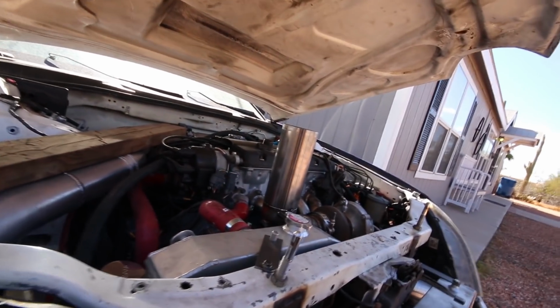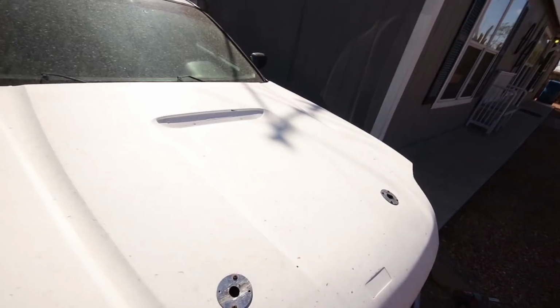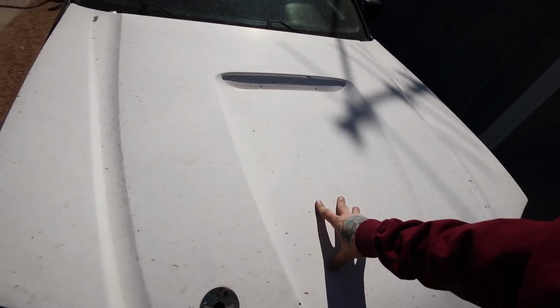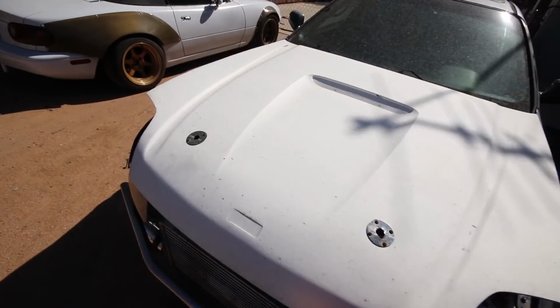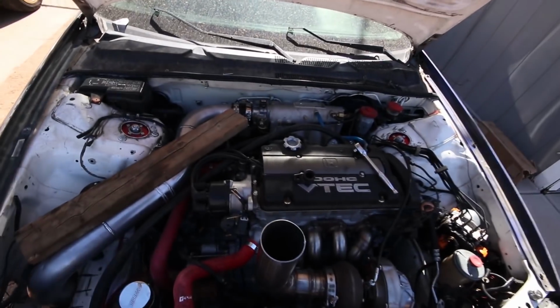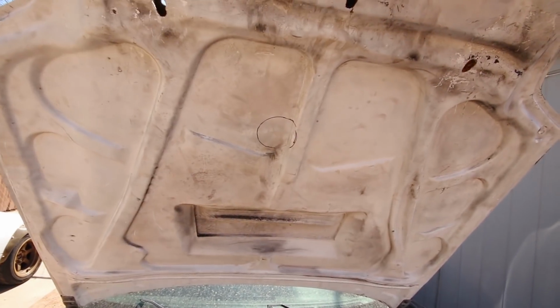Oh yeah, that'll definitely clear. I might even have to trim an inch or 2 off, but thankfully it's too long, not too short. So I'm gonna just try and push down on the hood a little bit, see if I can make a slight indentation on the fiberglass, so I know where to drill. Okay, I was able to fit my hand up there with a Sharpie. So, I have a 3-inch hole saw, but not a 3.5, so we're gonna have to do some hogging out.